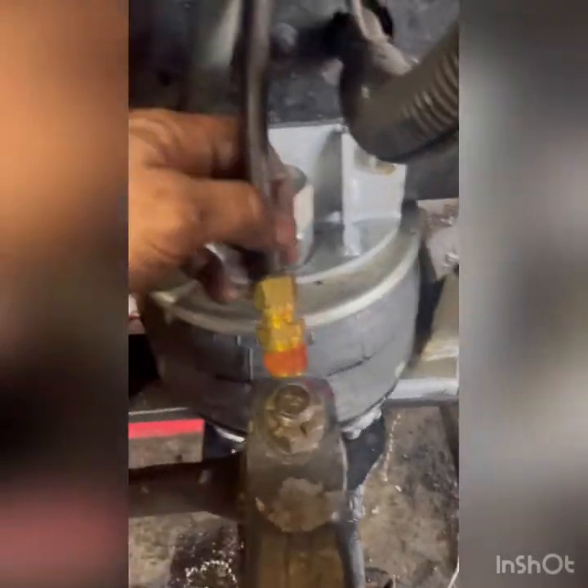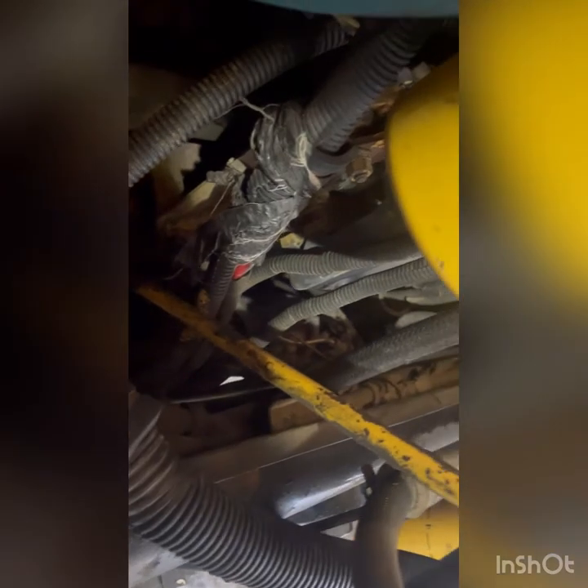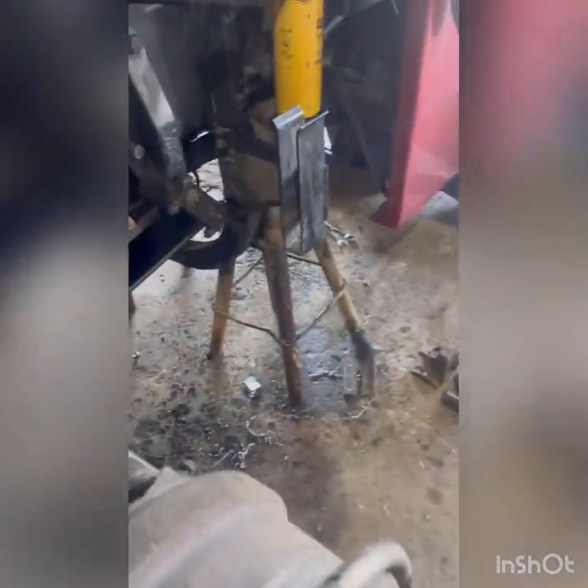On the left side, we've got the airline coming up through a hose bracket, back over the frame, down behind the frame. We're going to tie it back on the fuel line there, running it and tying it inside the frame all the way back to the next crossmember. Now we've got a line on the right side coming down, and a line on the left side coming out.